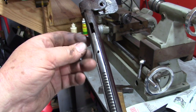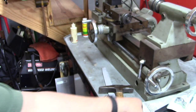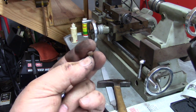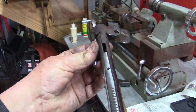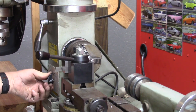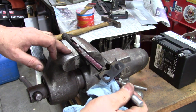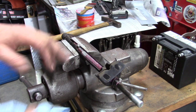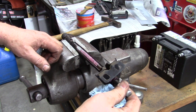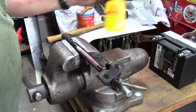I'll make it a press fit and try to keep the head on there. I'm going to manufacture something that looks close or at least gets the job done. I'm not a machinist so don't do as I do - I took the threads off and machined it down to the approximate size of the hole, which was 3.98 millimeters. Of course slightly smaller so it goes in there. I was hoping for a little bit better press fit but it's a little loose, so I used this Loctite glue here as opposed to JB Weld.